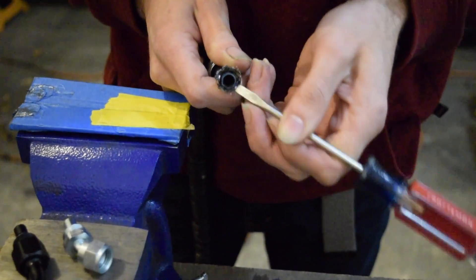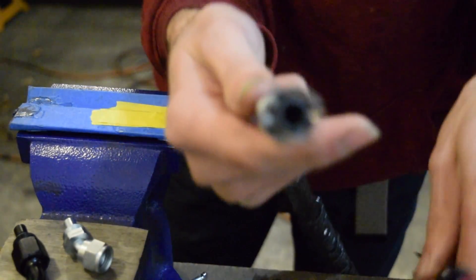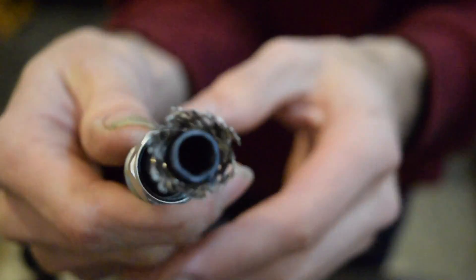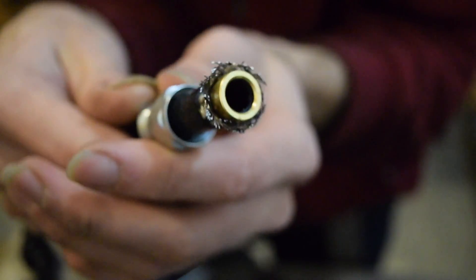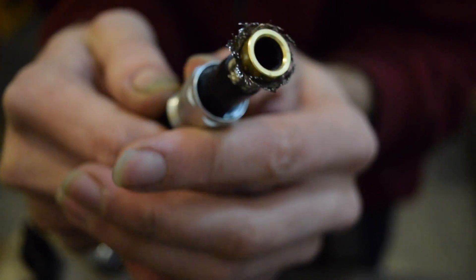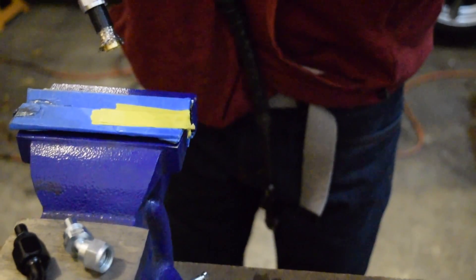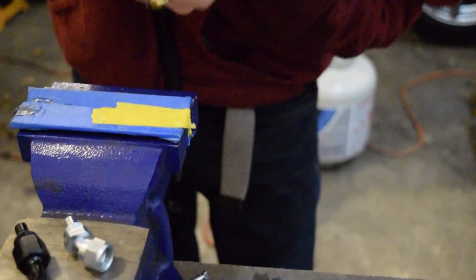Now that we've got it all opened up, this is what it should look like. The part that flares down, you want to go towards the hose. I'm going to push until it's seated all the way down — the Teflon is seated inside the lip of this copper ring, the copper ferrule. Once it is, then you're good. Sometimes I'll even press it on the vise or the table, whatever you're working on, so you know it's nice and seated.